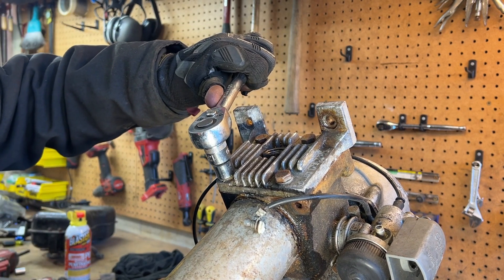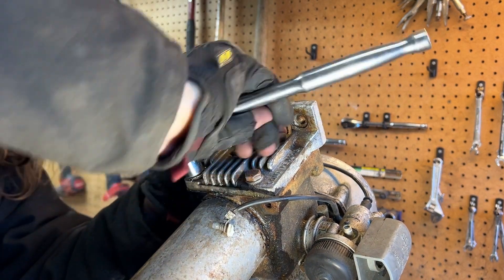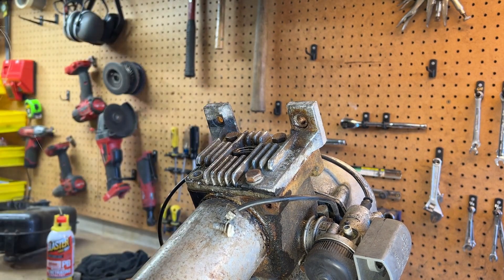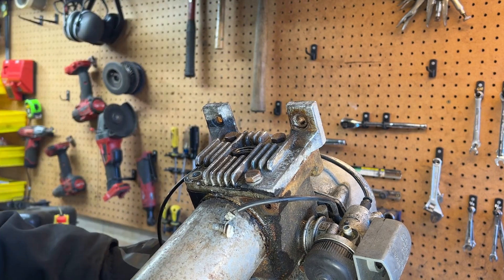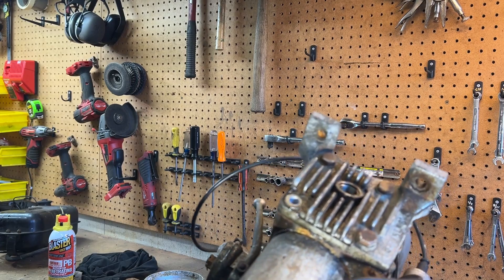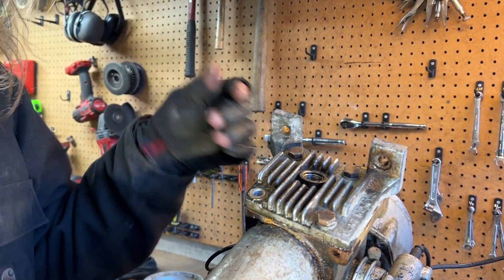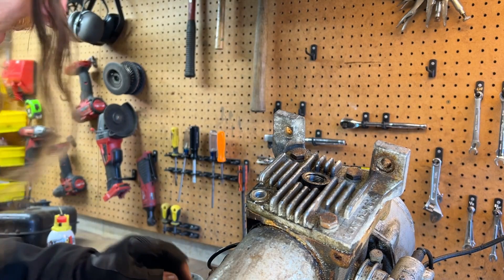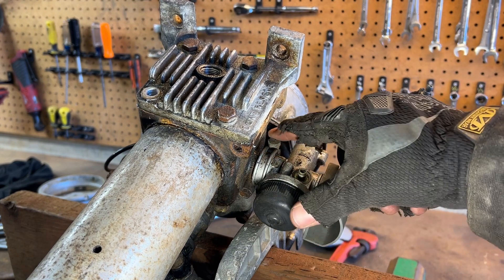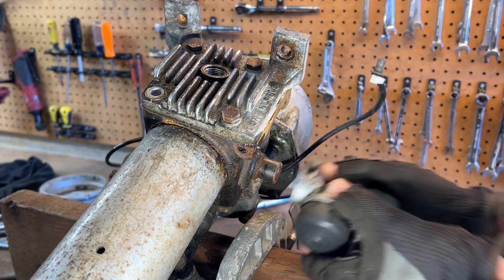Definitely does not feel good. That's what I thought. Is that why they say 'do not remove' - they know it's going to get all rusty? This thing is in bad shape. I just don't feel like that penetrating oil is going to do us any good in that combustion chamber. I think every one of these is going to snap. I could torch them, but I think it's kind of for our own entertainment at this point. You know what we could do - let's pull the carburetor and look and see if we can check out the intake ports. Can we see anything? Can't see much.